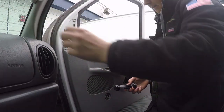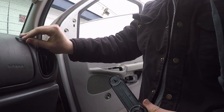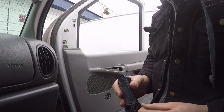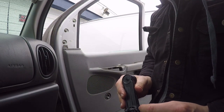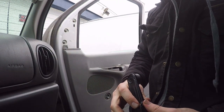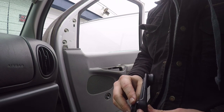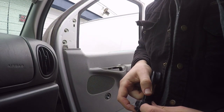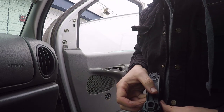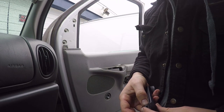What I was telling you to pry on — you're going to pry between the door panel and the car body with your big flathead screwdriver. This lip is actually what holds the clip on. You can see there's a lip on this side and on this side, and that's what's holding this outer panel on.